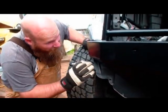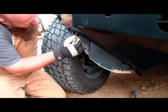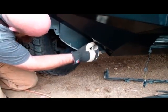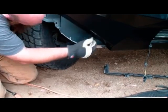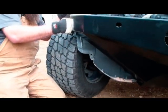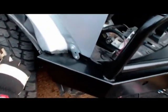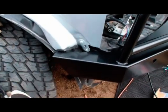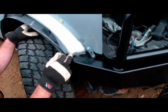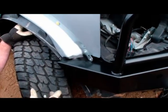While Kip is holding the bumper secure where it's going to sit, I'm going to mark the plastic inner fender skirt, following the line of the bumper all the way down so we can trim it to fit nicely. On the back side you need to put two relief cuts in the lip so that it will tuck inside the fender on the back side of the bumper. Make sure you have plenty of room along the steel so the bumper and the steel part of the fender skirt won't hit and cause a rattle.